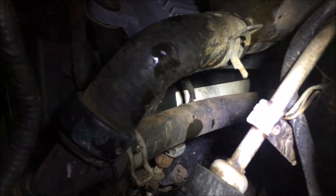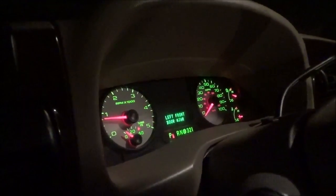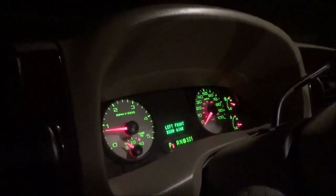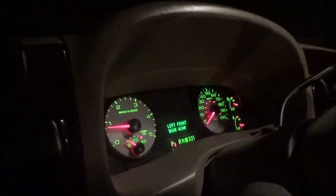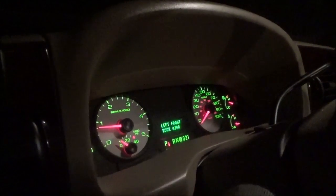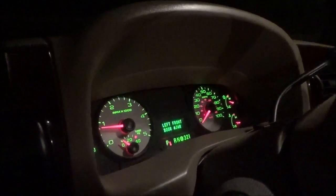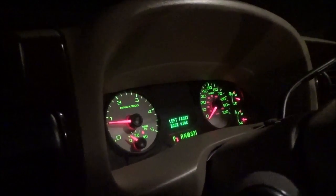I had the cap off, sitting there looking, and I could see this drip. After I saw that I was pretty relieved — I thought I could just put a hose clamp on there, so I'm not going to put any stop leak in. But then when I put the cap on, it shows right on top that that system actually pressurizes to about 10 pounds per square inch. I took a drip video with my cell phone and then it started to drip faster. Now that I've put the cap on, it's not the actual hose that's leaking — there's a leak in the actual reservoir.